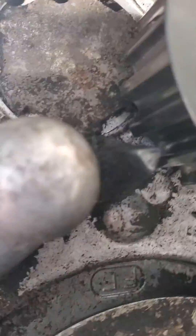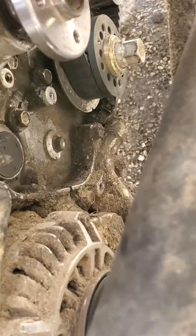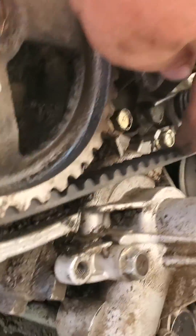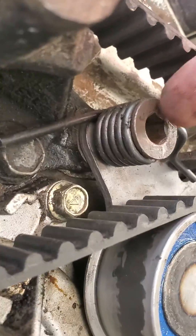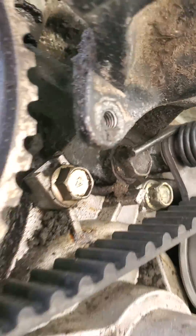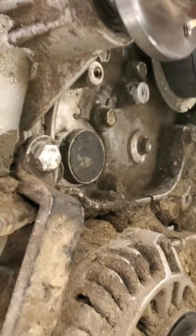There's a notch on the front plate up here and it lines up to a little stud up there — it's a triangle-shaped stud, you can feel it. You've got to crank around and tighten that by hand. I replaced that pulley and the spring as well. You tighten this 9/16 or 14mm first, then tighten the 10mm nut that holds the spring, and make sure it's got a quick tension.